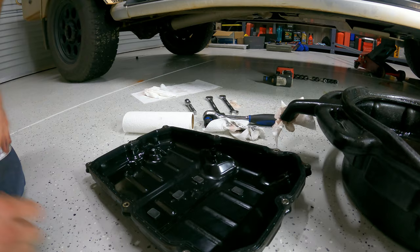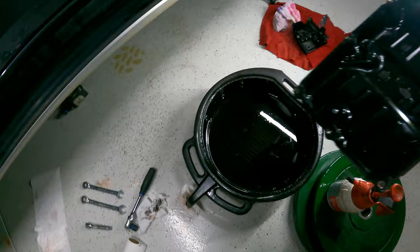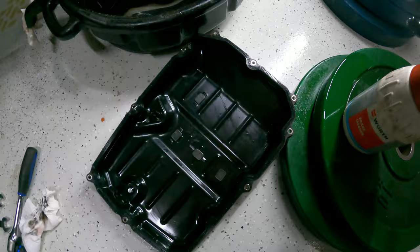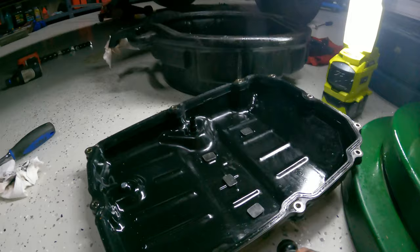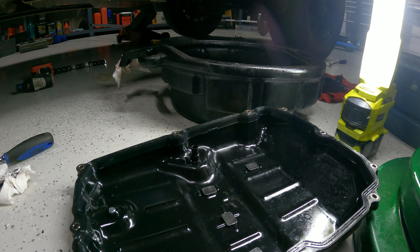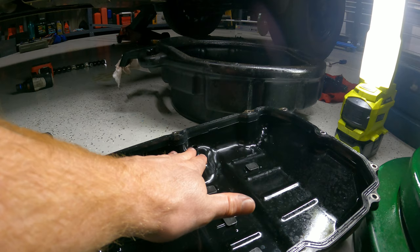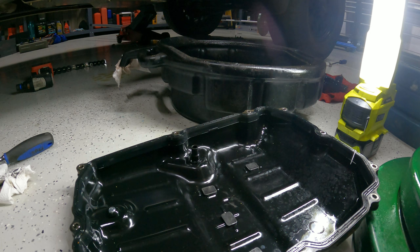Trans pan's clean. Just so you can see — the black color doesn't show too well in the light. Where the allen key is, when you're setting your level, the oil level actually comes over the top of this tube here. You just want a little trickle coming out of the level plug — that allen key from underneath. When your car is running, that's how much oil sits in the trans sump, right up to here, and we set that at about 36 degrees.